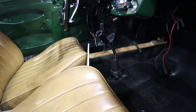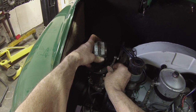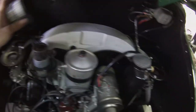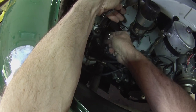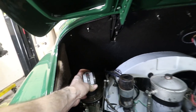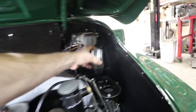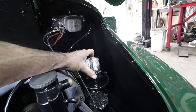Now we put the stick on the gas pedal and rev it up. With that piece of wood holding it open, we get readings of ten, ten, and also ten. So that's the synchronization procedure complete at about 2500 to 3000 rpm.